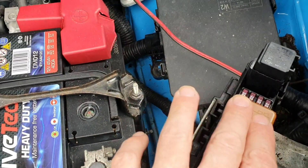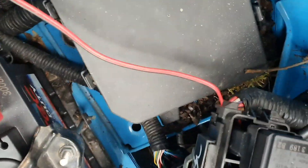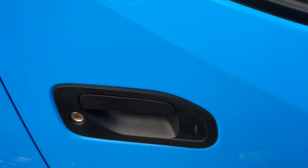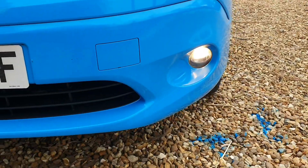I've put everything back together — we have the daylight driving relay back in place, and then we have a wire coming out the back here, following where I wired up the other inverter cable. Coming around inside the cabin, I've wired it down to a switch under the dash so it is out of the way. If I switch it on, there we go — relay is on and the driving lights are working.